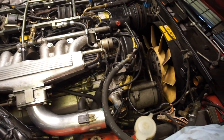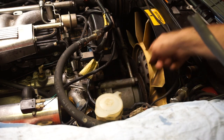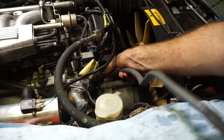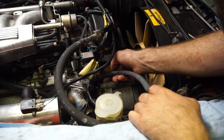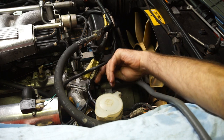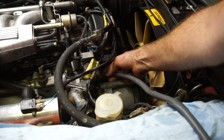Now I'm going to do the block and try to film that without getting the camera too wet — fortunately I don't have a waterproof camera. Since the thermostats are still in this engine, to flush the block I'm going to use where the bypass hose goes. I'll shove the hose in there and it should come out of the water pump. I can already hear it coming out of the bottom of the water pump. It's going to be really hard to show that on camera without getting it soaking wet, but it's actually looking really nice and clean — so far it's only clean water coming out. I'm going to let it run for a little bit from this side and then I'll do the other side as well.